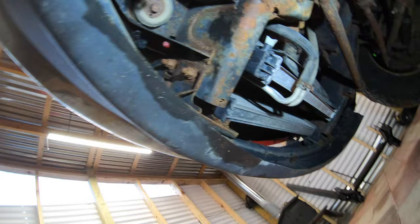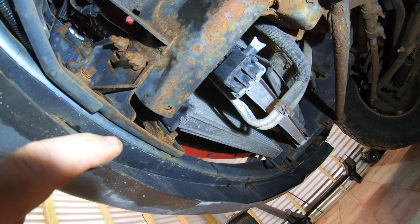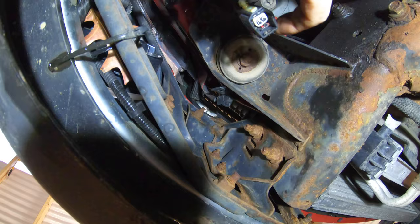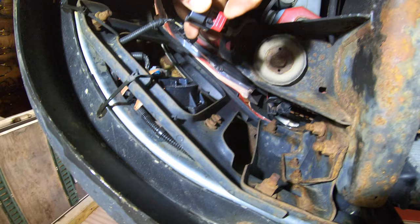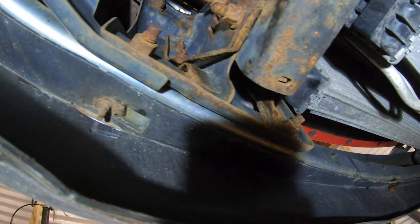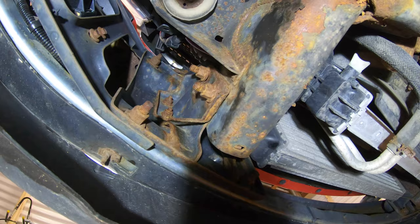I did a good looking over on this bumper to see how it disconnects, and it appears to be extremely simple. I have this one connector right here which I believe is for the fog lights. There's a little red tab right here that you slide back — that unlocks this connector and allows you to disconnect it. That gives power down into the lower bumper for the fog lights. If your truck doesn't have fog lights, you probably don't have that.